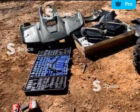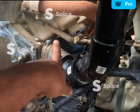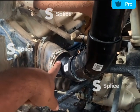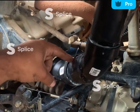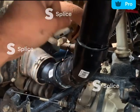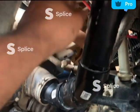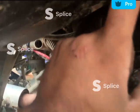45, 2-inch. I put tape filler on the outside, then I'll go over with just a little bit of silicone, not enough to seal it, but just to give it some space to fill in the gaps, and then you tighten it down. 45, probably use about 3 to 4 inches of 2-inch pipe. And then a 45 up, and then probably like 7 inches. Elbow, straight piece, probably about 4 to 5 inches. Elbow, and then straight out the top.